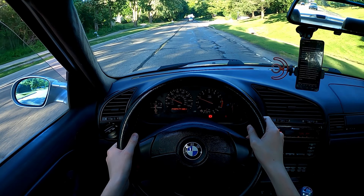Emergency braking from highway speeds is very good — I wouldn't hesitate to run these on a daily driver again. The pedal modulation is also very good. The initial press is softer, similar to a factory pad, but once you really get your foot into it, it stiffens up and brakes the way you'd want a performance pad to. These also don't produce a lot of brake dust — more than factory, but with a weekly wash and light wheel cleaner it comes off easily.